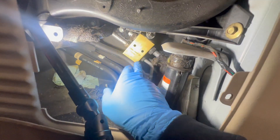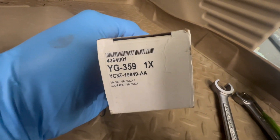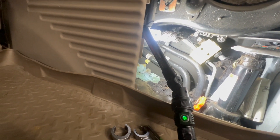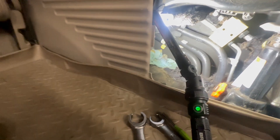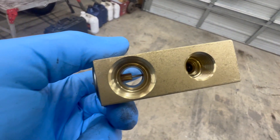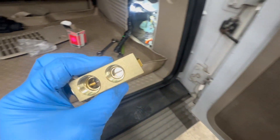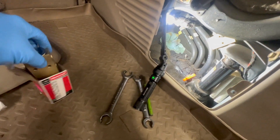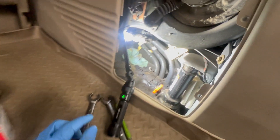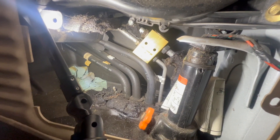On the back of these Excursions you have what's called a thermostatic valve right there. Here's the new one — Motorcraft — and there's your part number. This is not super common but these do go out in the back. You can see it's got an orifice that's cracked open on the bottom and it's wide open on the top right now. What this basically does is restrict and control the flow of the freon to the rear evaporator.